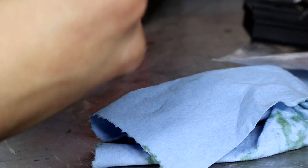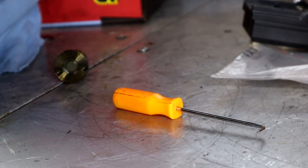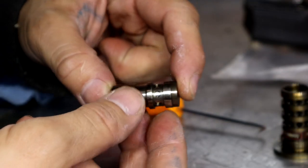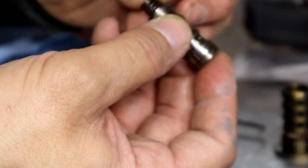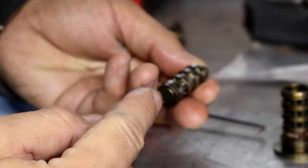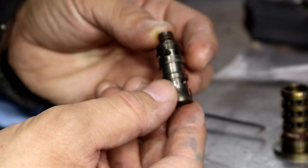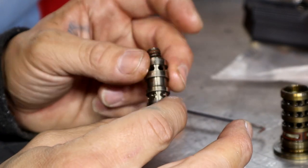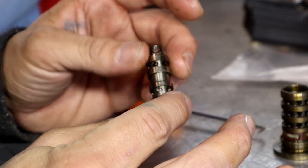And then there's this piston in here, which comes out eventually. So this is what's being pushed on, essentially. Here's the piston, and here's the return spring for it. It just sits on the back, so when the magnet pushes on this end of it, it goes, and then the spring pushes it back. But you can see this one's fine. I think this was the exhaust one.